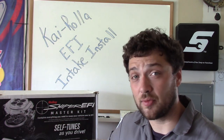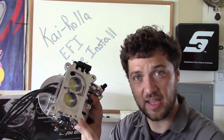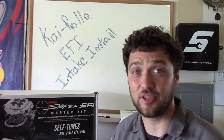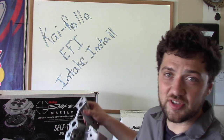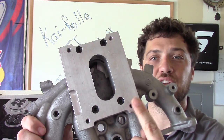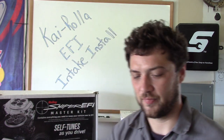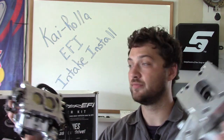The only challenge we came across was we needed a way to bolt the classic Holley two-barrel flange on the bottom of the Sniper EFI to our 2TC engine. So we called up BRD Racing, a shop that specializes in 2TC and 3TC engines, and let them know what we were doing. What we ended up with was their 3TC intake with a special two-barrel Holley flange adapter. This thing is beautiful — polished up really nicely and they even set it down on a milling machine and match-ported it. This is the final piece we need to mount our Sniper to the Corolla.